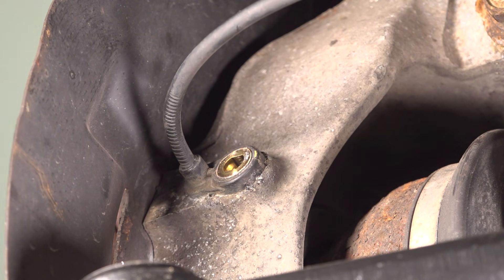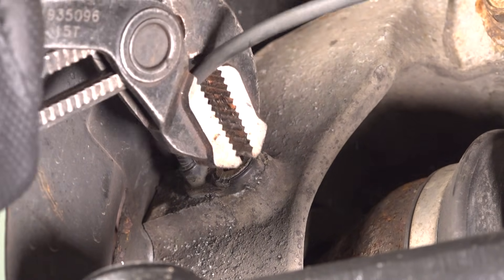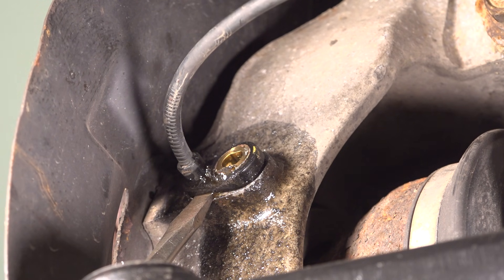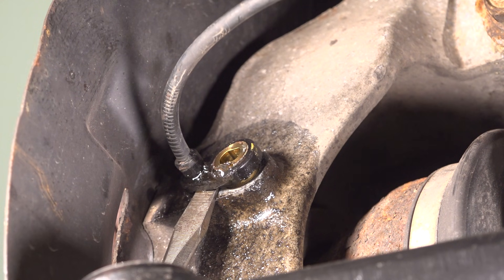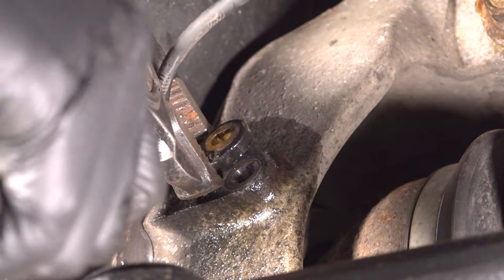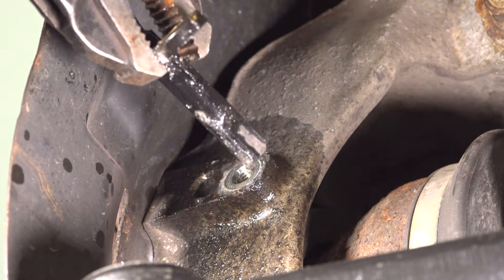However, this one is fairly stuck. So with some pliers, I'm going to very gently grab it right on the base and give it a couple twists — hopefully that breaks it free without actually breaking it. I'm going to spray a little bit of rust penetrant all over so it gets inside and breaks free the rust. With a flat blade screwdriver, I'm going to try and get right on the base of it, tap it in — this should put some outward pressure on it. It came out. If it doesn't pop out, leave the screwdriver in but continue twisting with the pliers. And that is a saved ABS sensor — gently set this aside where it cannot get damaged.